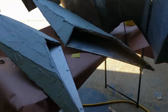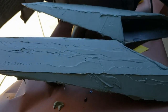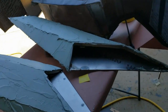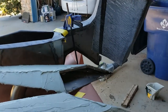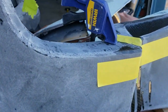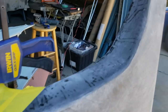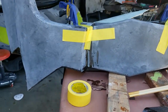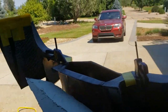Over here, what we've done is we've actually put the pipes in on our scoops so that we can hook that up to our air filters and our turbo, and then we've slathered them with some filler. I've been told to put it on thick and sand it thin, so that's what we're doing here. What we've got left to do is sand these ends after they cure, fix some of these drips, runs, and irregularities. Once we do that, we can sand the whole thing down, clear coat it, and get it back on the car. We're making progress — slow but sure.